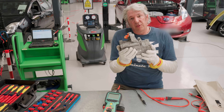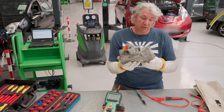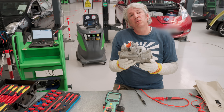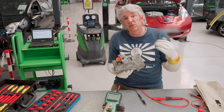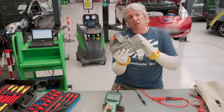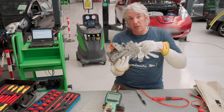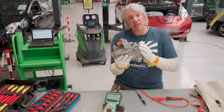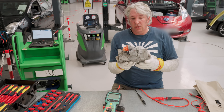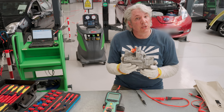Having established there is actually a problem with the electrical side of our electric compressor, unfortunately it's not a user serviceable part — it'd be much the same if there was an issue with the pump itself. So that means we need to replace it with a brand new one. But once you put that onto the car and bolt it up, there is one last test we have to do: the equipotential test, to make sure that there is no potential difference between all the components bolted onto the vehicle. You do another continuity test between the casing of the new compressor, the DC-to-DC converter, and the motor itself. Once we're happy that is less than 0.1 of an ohm — basically a dead short — then we're all good to go.